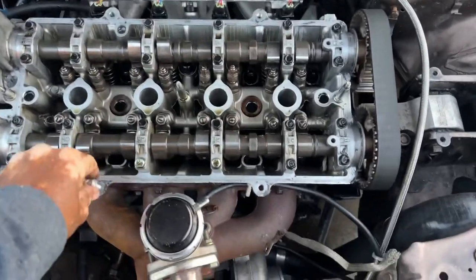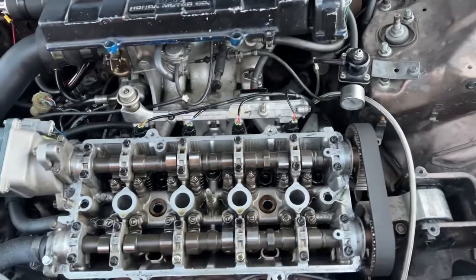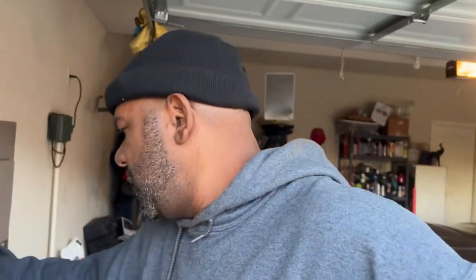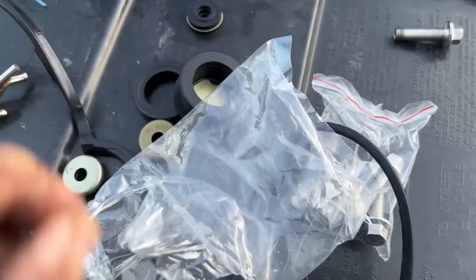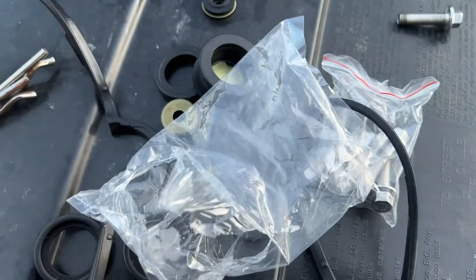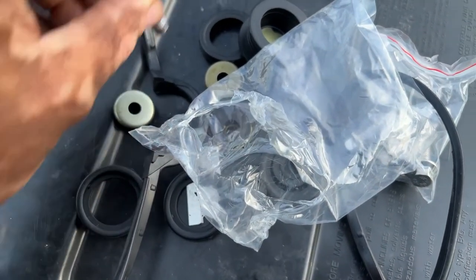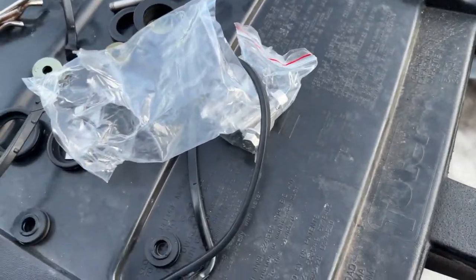Before I put this gasket on, I need to coordinate. I need the RTV in the corners, then put the gasket on. I got one shot — I ain't messing up another gasket. This kit is actually pretty good. It came with the little grommets and the metal piece too. Instead of using these new metal pieces, I'm going to use the old ones and drill the diameter out just a little bit so the bolt slides in there nice. The rubber and plastic are fine — it's just the little metal piece that needs adjustment. I'll drill out the old ones so I won't mess up the new ones.